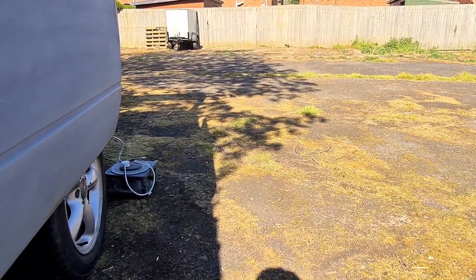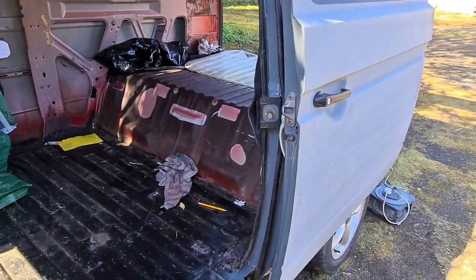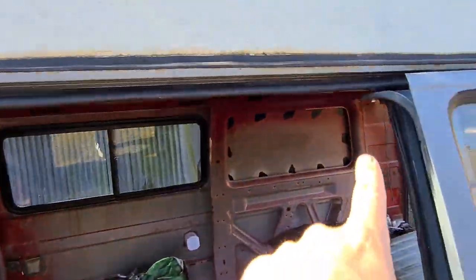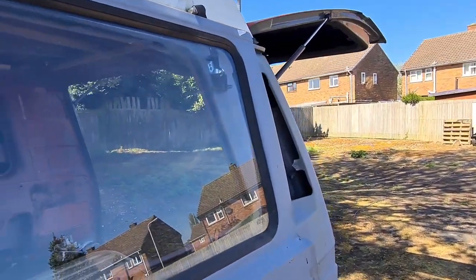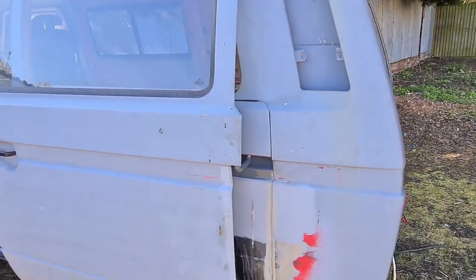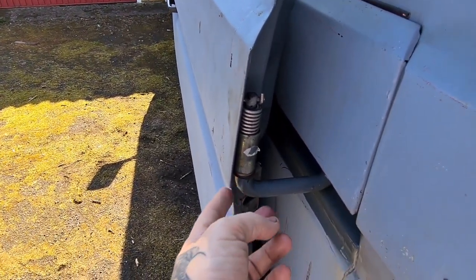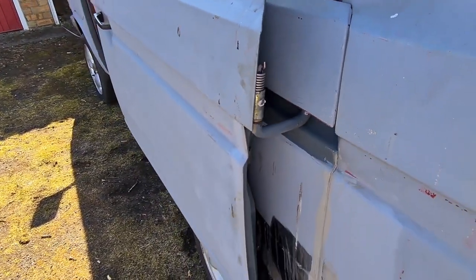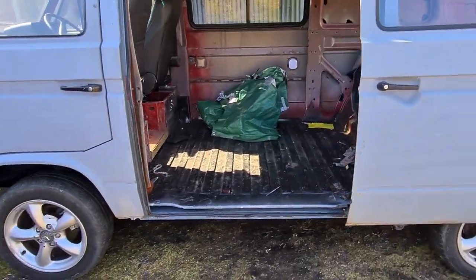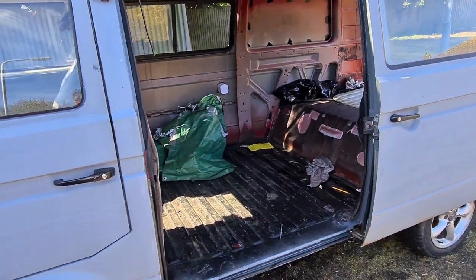Obviously, to put the door back on, I did it slightly differently, and I'll explain what I did just quickly for you. So same process there at the bottom, in at 90 degrees, turn it round, put that bolt back in the top, and then what I actually did, because I found it was easier, I slid the door and I closed the door on there, and then I put this bracket in, the sliding door bracket as you call it, in, and that was it, guys. So yeah, job's done anyway, all inside's nicely painted. So that's a job well done.